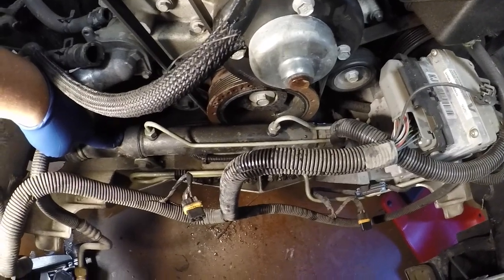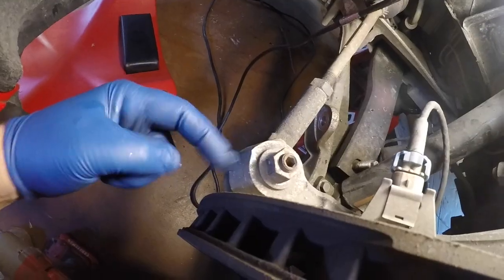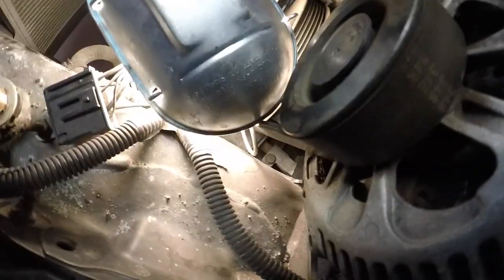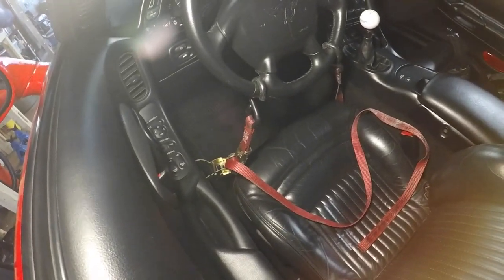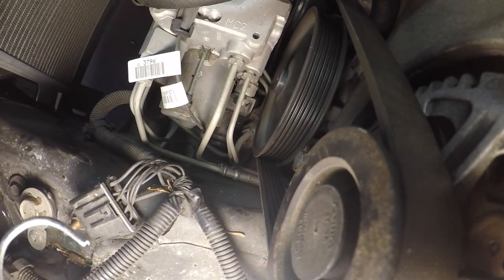With the radiator out we are ready to start on getting the steering rack out, which is arguably the hardest part of this job. We're going to start on each side of the car removing the steering end links. Before we go any further, I'm going to get out as much power steering fluid as possible. Next I'm going to remove the steering shaft — there's a 13 millimeter bolt holding the steering shaft onto the gearbox. I've also strategically placed a ratchet strap around the seat rails and onto the steering wheel to hold it straight. Now with an 18 millimeter crow's foot wrench we need to remove the two power steering lines attached to the gearbox.